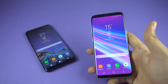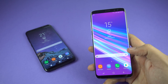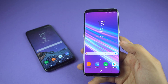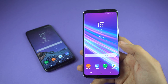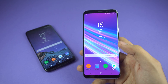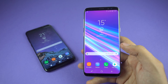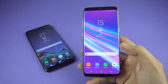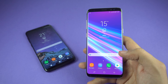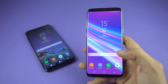A big thanks to Paradox from XDA forums. He actually made it possible for the Exynos Galaxy S8, since the Android 8.0 beta is currently for Qualcomm Galaxy S8 devices. He made a flashable zip file for the Exynos variant, making that process incredibly easy. If you want to install it, check the first link in the description — you install three files in order, and all you need is a custom TWRP recovery running on your Galaxy S8.